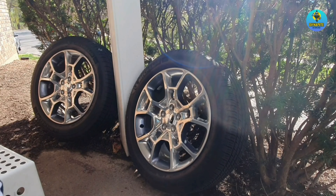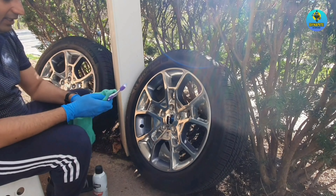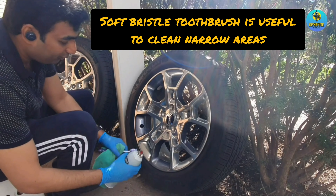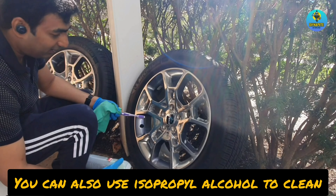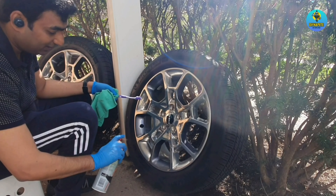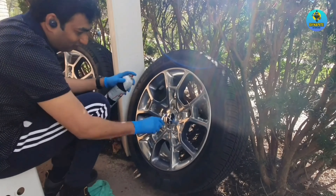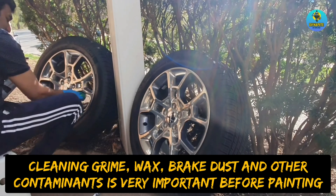While the calipers dry out, let's begin with cleaning our wheels. I'm going to use a toothbrush and a brake cleaner spray. If you don't have a pre-dip spray, you can use brake cleaner or any cleaner spray. Make sure all the crevices and edges of the spokes are clean — use a brush where it's hard to reach, then use a clean cloth to wipe it down.